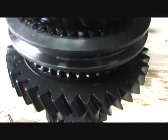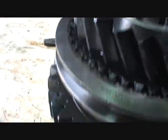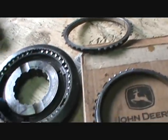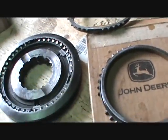When you're going to change again, it's just so it doesn't grind the gears. Because the gear grinding you hear when you pull this thing without pushing in the clutch is not actually these gears here, which a lot of people think. It's actually these little guys here and this shifting collar — that high-pitched sound you hear when you're getting a little out of control with your shifting. That's this guy. And of course, that's what happens when your synchros go bad.